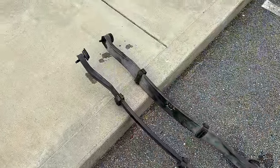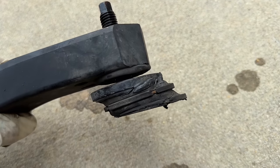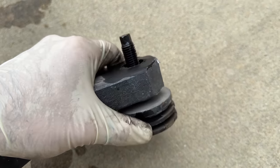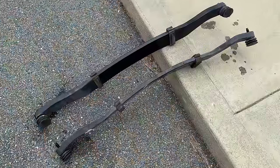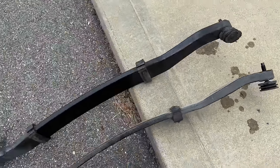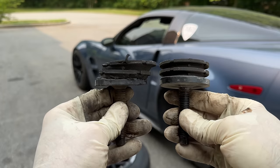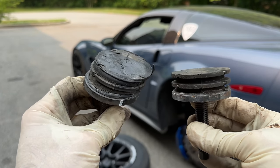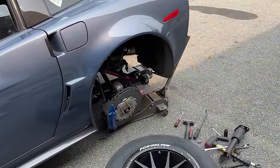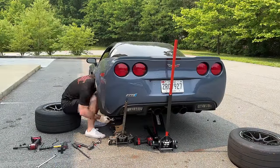Based on what we're doing right now, I probably don't need to tell you which leaf spring came off my car and which one I just grabbed out of inventory. This is easily one of the most destroyed lowering bolt pads I've ever seen. Luckily, we had this one off a stock Grand Sport — it's actually really nice. Unfortunately, the leaf springs themselves are different, so we do have to pull these bolts out and put it into the ZR1 spring. I knew they were bad, but I didn't know they were this bad. If I did, I'd probably have made it a point to replace them a lot sooner. We had to do this at some point, and now the next time we have to adjust the height, it's as simple as putting the car in the air and spinning a bolt.